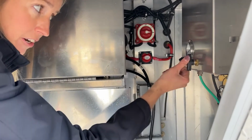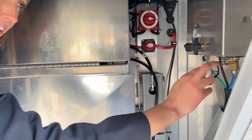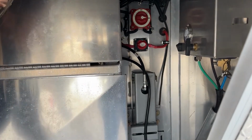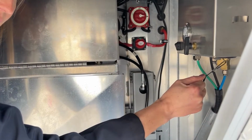When you're done with it, turn it to lower, turn it off. And then really important, guys, is this air ride right here, or this dump valve. Just make sure when you are done and you're going to set at a horse show for a week or a weekend, you make sure to take all the air out of that line.